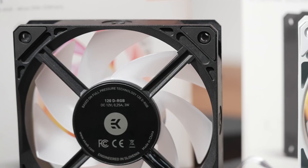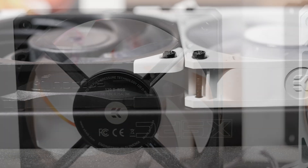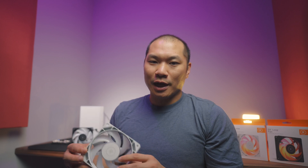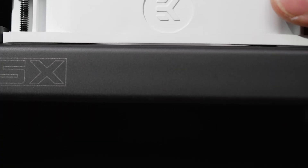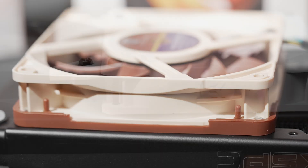There's also a 140mm version of this Loop fan. FPT stands for Full Pressure Technology. EK's intent for this design is that the entire frame of the fan should sit flush on the radiator to minimize leakage. There's a very thin rubber pad, though, which offsets it just a little bit. It is thinner than the NF-A12x25 rubber pads, allowing these to sit closer. In practice it's not perfectly flush — you'll still see a gap, and it's not until you use a gasket like Noctua provides on their A12x25 that you'll see an airtight connection, although this really isn't too bad at all.